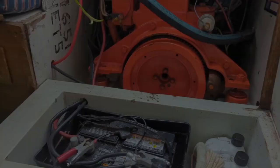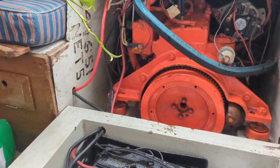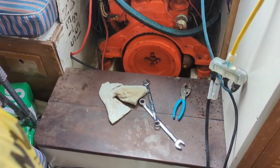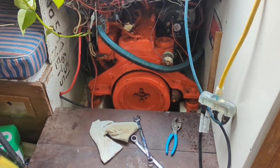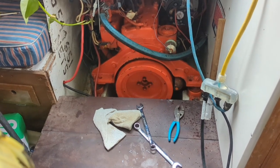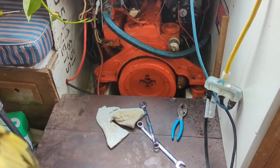Not good. I'm stumped. I've tried to get the starter to go — I've hit it with a hammer, I've shorted it out, nothing. I'm positive it's not the batteries; they've been charging long enough and they're all about 13 volts. I'm going to try to skip the solenoid by putting pliers to connect the two points. I don't think it's the starter itself — it's the solenoid clicking. I'm going to try to bypass the ground to the starter to see if that's the problem.